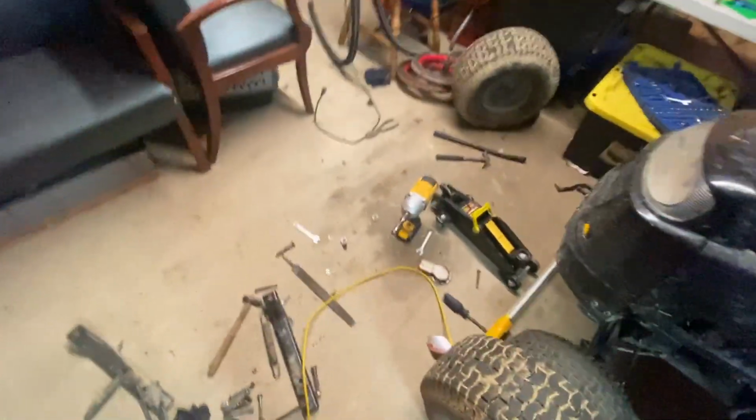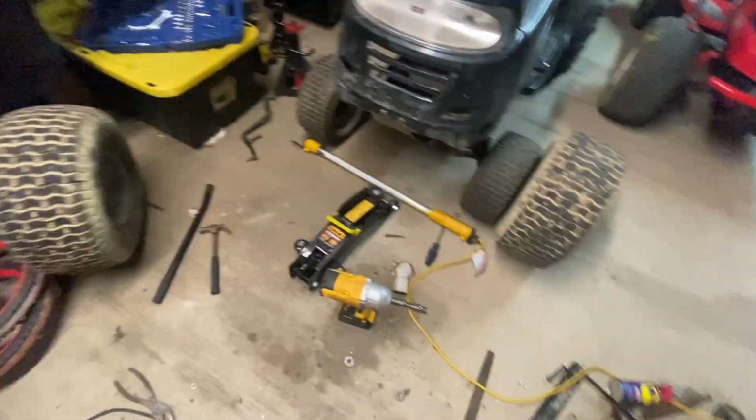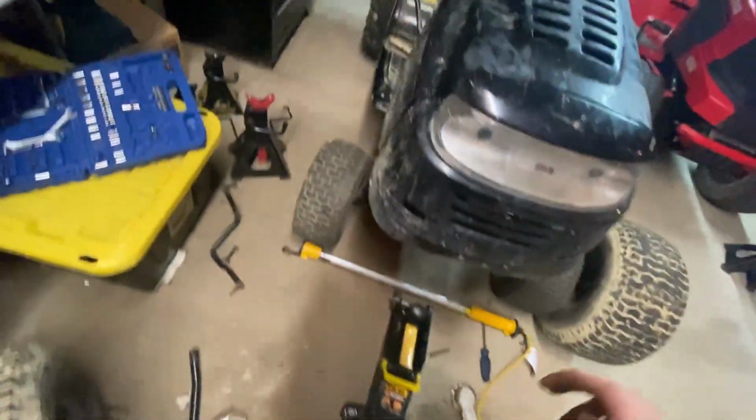But it's not any louder. It still has a muffler on it. If it's an overhead valve, keep the muffler on it. It'll damage the valves. Even the flatheads need some back pressure. It's not good for them either. Burn the valves, really.